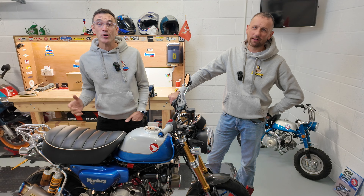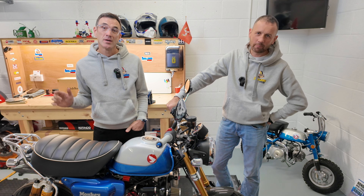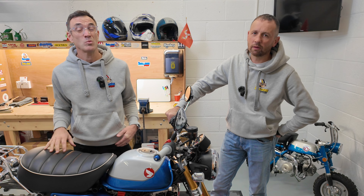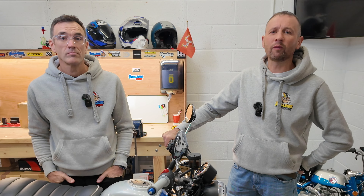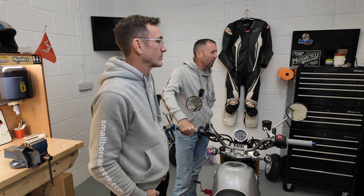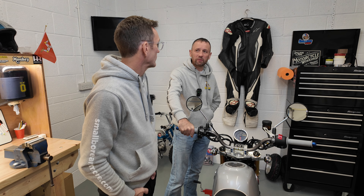If you're thinking of doing a 145 Big Bore kit on your Honda Grom or Monkey, you want to watch this video first. A few months back we created the 125 Monkey with the Kitako 145 kit which has got a bigger piston, barrel and a cam, and to be fair we've been really impressed with the performance. Performance aside, we thought it sounded a little bit rattly from the top end, and there's been a lot of comments on social media with other people saying they've heard similar noises at medium and high revs — especially under load it sounded very tappity.